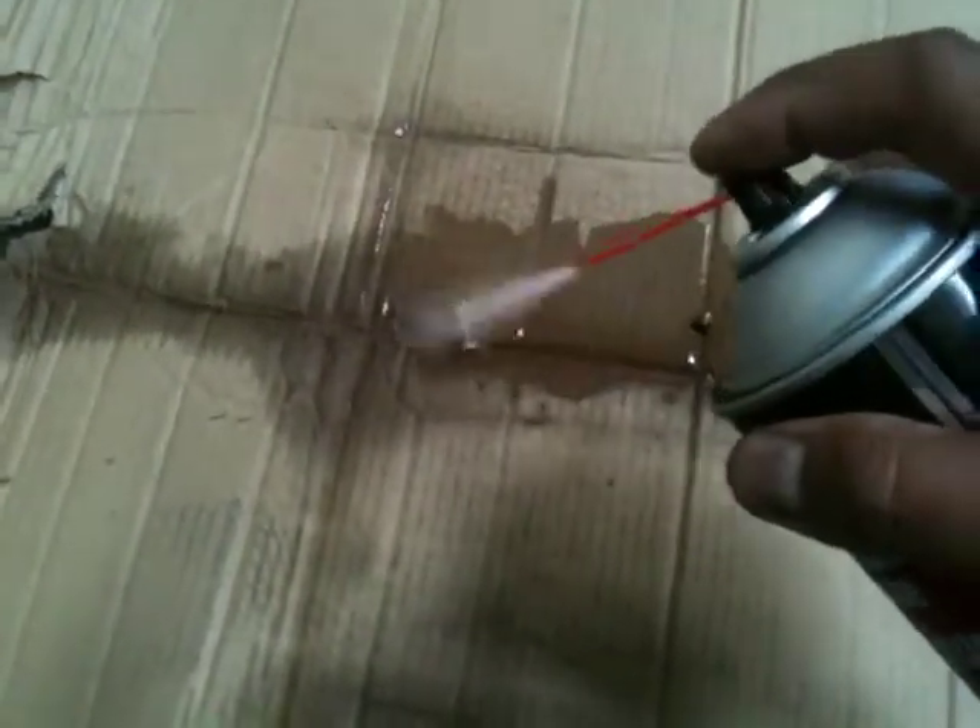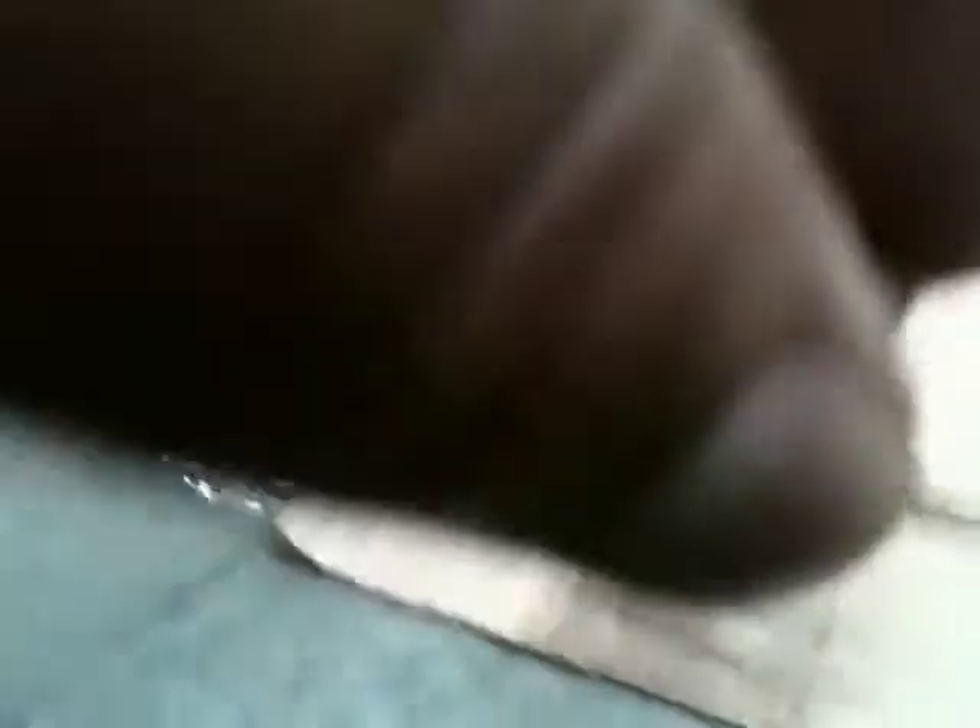Put it back here in the cardboard, clean the outside, spray it a little bit. I'm out of rags so I'm using paper towels, which is not a bad idea as well. Just clean the outside — since the jets are big and you can actually see through it, I would just clean it on the outside. If you have a thicker bristle or wire that goes through, that would be great as well. So I'll just do this, clean it, and also spray carburetor cleaner through it. Dry it off and our main jet is clean, then its body — same thing.